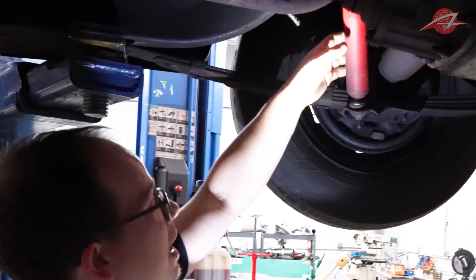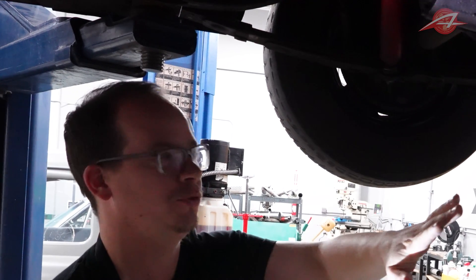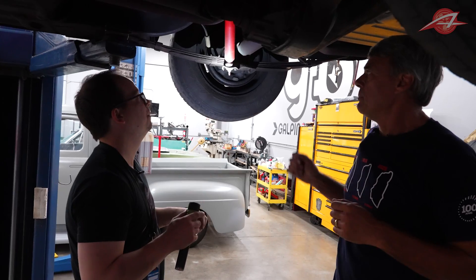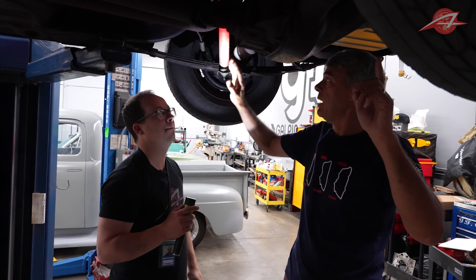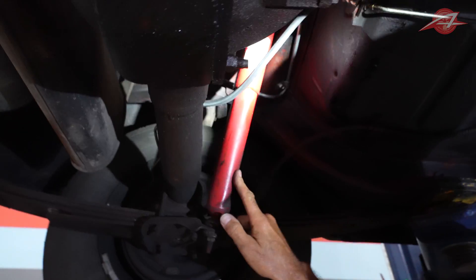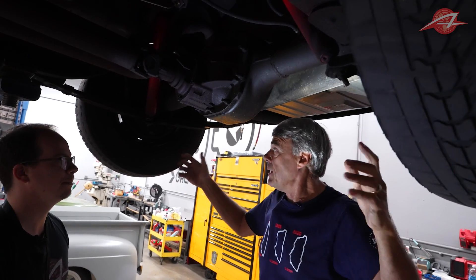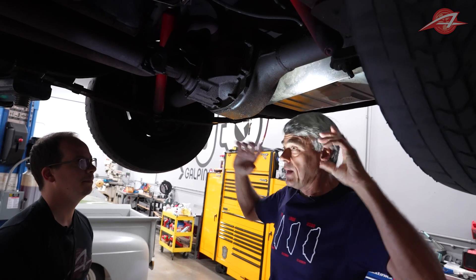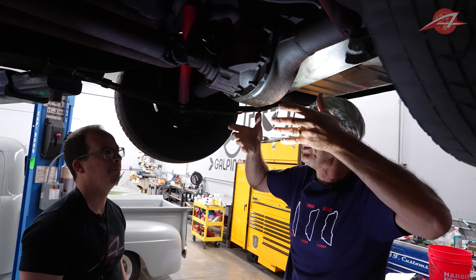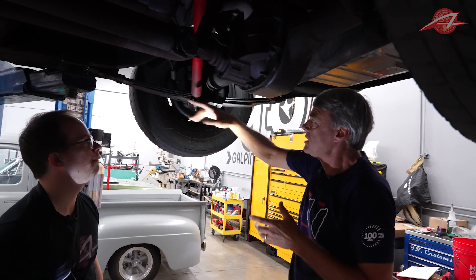The shocks on this are both on the same side of the axle, whereas when I'm trailing a truck in traffic today I always see one in front and one behind. Modern day solid axles will have one shock on the front of the axle and one shock mounted behind the axle. The reason for that is when you apply torque to a solid axle to try to get the car to roll forward, the wheels are trying to roll forward but the axle is trying to roll in the opposite direction, and the only thing resisting that is the springs.